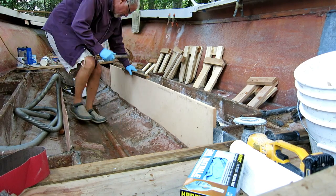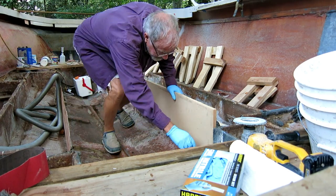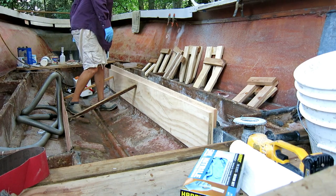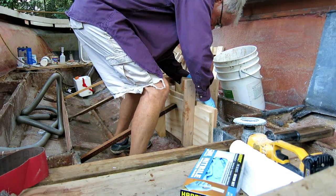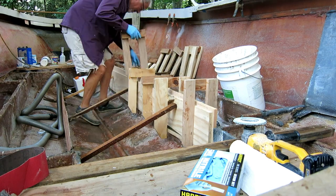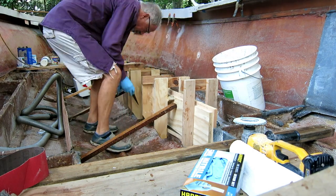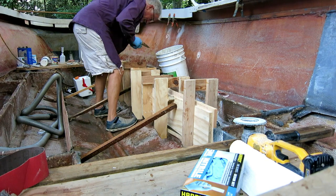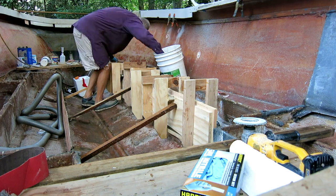I pushed the stringer to the outside of the boat because it had a tendency to lean in, using little sticks to hold it, then started putting the clamps. I have plywood on the back side of the stringer too, so I'm clamping the foam to the existing stringer with plywood on both sides and lots of little wedges. Pretty happy with the way the whole thing turned out. I'll do the other one tomorrow morning while it's cool. After this, everything gets on a smaller scale - this is by far the largest single clamping I'm going to have to do. After this it's just a lot of installing resin and mat for the stringer.